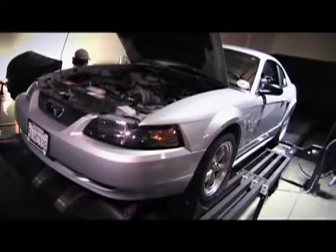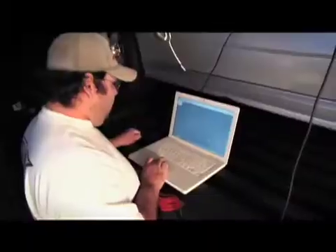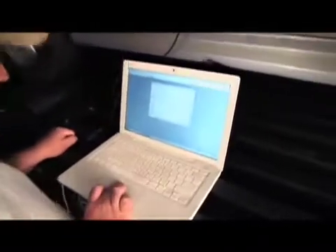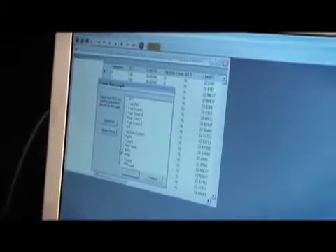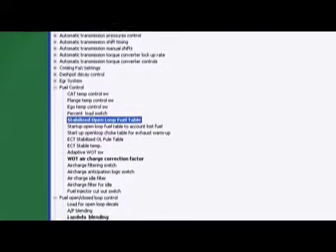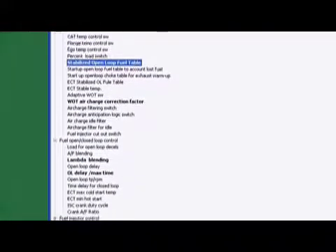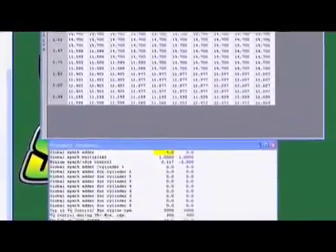The programmed tune picked up three horsepower. From there we decided to modify the tune a bit. You can load the tune file back into Special Forces, advancing the screens to bring up basic fuel and timing adjustments. If you have the Delta Force or Commando tuning software, you can modify your tune like a full standalone by loading your tune and template file. You can also compare two tune files, which will highlight the areas that were changed between them.